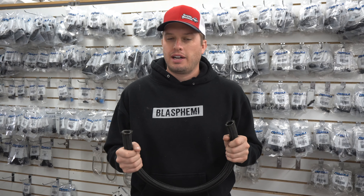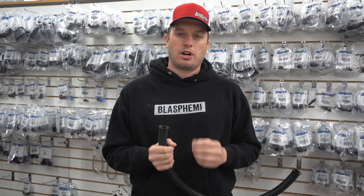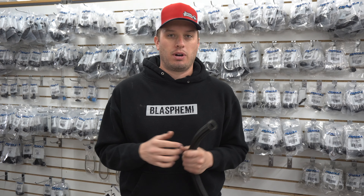There are a variety of ways to do that, but the dirtiest your fuel system is ever going to be is when you assemble it and start the car for the first time. That's because there's dust from our facility sitting in there, dust from when it's manufactured, dust from your garage, and dust from assembling it. More times than I can count, every week we get people calling in.